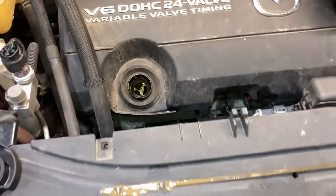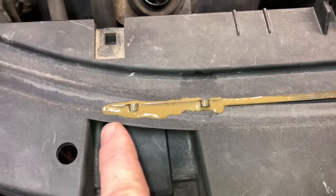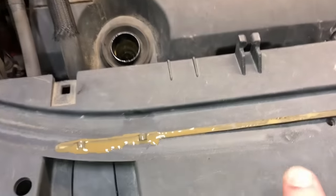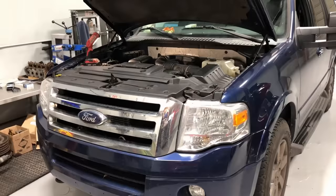The next thing to do is pull your oil dipstick. This is not normal - even if you had short driving trips and condensation on the fill cap, an engine with no issues would have clean regular engine oil. This creamy, milky condition is not normal.